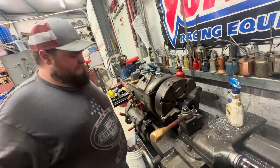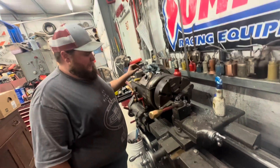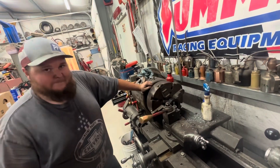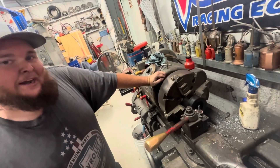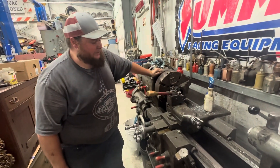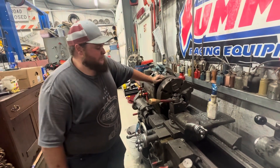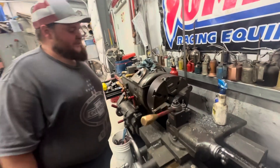The prediction is it blows up on the stand — that's the most likely option. Everybody says LB7 pistons are better, but I think LB7 pistons are only better because they don't have the rod to support higher horsepower. We're going to find out and give it every chance we can. It's going to drop the compression a lot, which we have to do for the alternate fire cam, but we're going to see how far LB7 pistons can be taken.